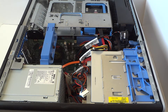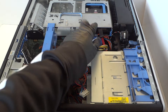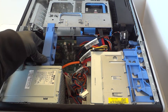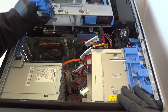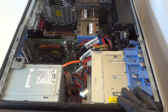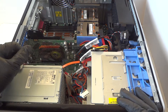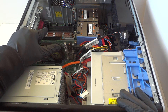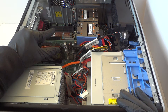It's a pretty nice machine. It's got a 750 watt power supply in here. One hard drive installed, installing another one in here. Remove the regular clip right here, lift this up. I've got a dual Xeon processor in here, each running a dual core — so each processor is a dual core three gigahertz. It's got four gigs of memory in here and I'm gonna add two more sticks.